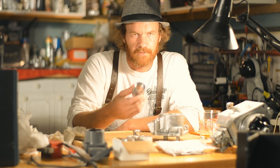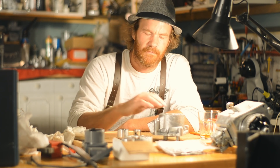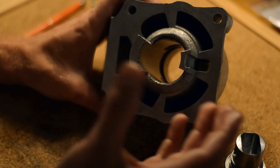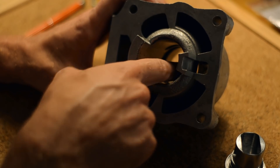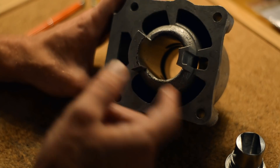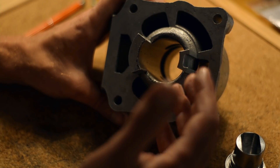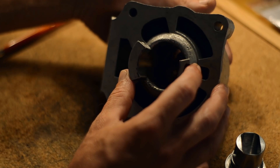I have to do some thinking here — we're not done with this yet. I really do want to run the Speed of Cheese Mark Atkinson pistons, but without the stepped ring in normal cylinders. There's more to this cylinder than the 100% of bore exhaust port: large radius between the bore and the transfers — the transfer-bore interface. Nice uniform flow. The angles of the transfer walls are retained from the entrance to the exit, to get the most control possible over the transfer flows. I'm going for a lot of volume, thinking low velocity high pressure versus high velocity low pressure, to keep control — and the low velocity high pressure might be less susceptible to penetration from the exhaust residue in the cylinder.